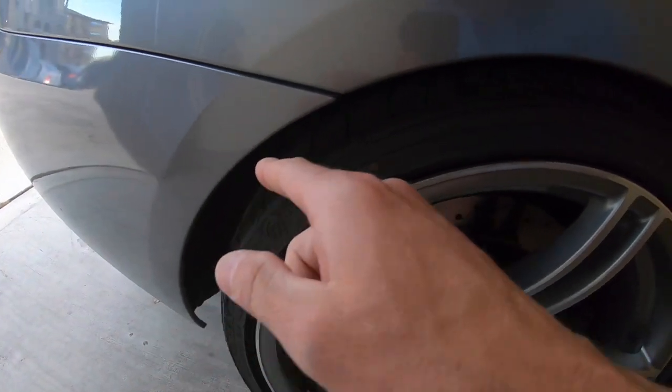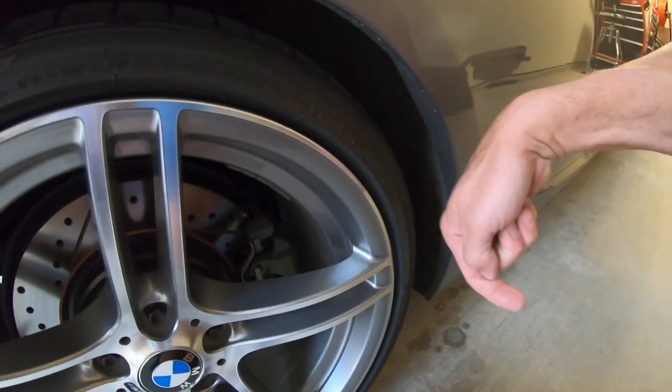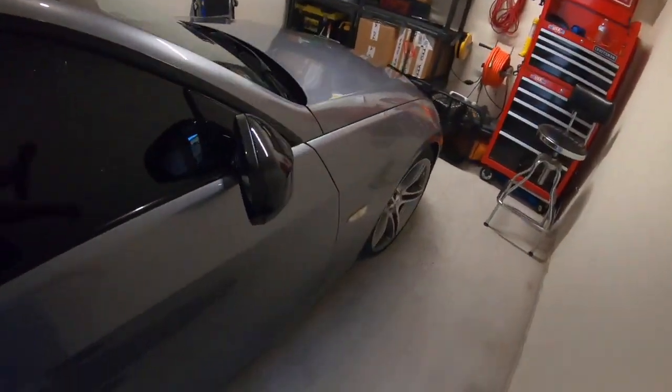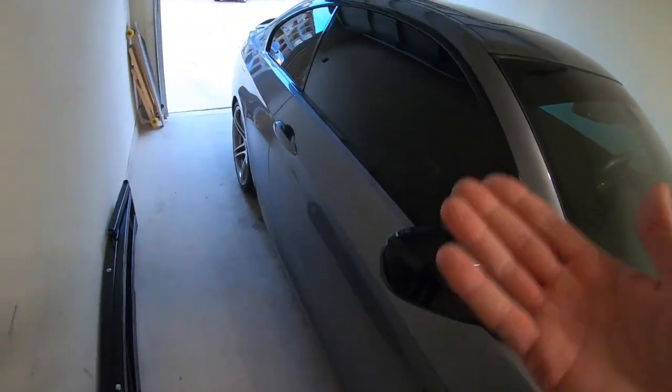One other thing to remove when setting up for this job is underneath the car where you have this lower cover running along just underneath the kick panel. There are plastic retaining screws — I believe it's a torx fitting — remove those along the length of the car. I use a quick jack, and once you have the car elevated, you need to remove those before lifting. Since I couldn't get some of these off due to the jack being in the way, I ended up just having to flap the cover down and reach up in there to run the wires and zip ties to secure it along the battery cable. Remove those screws for that lower cover so when the car is lifted you can get that cover down and make it a lot easier.